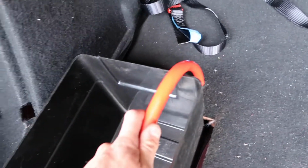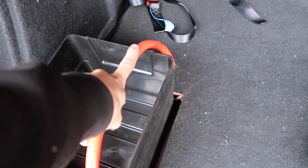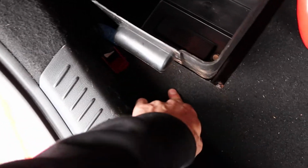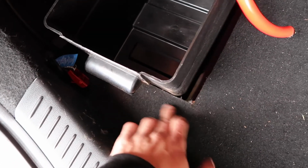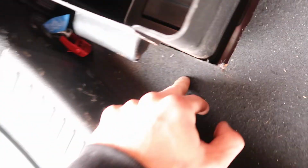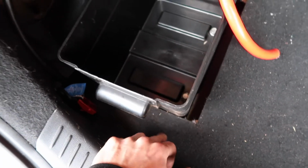It is still secured in place. It's not like it's gonna go anywhere. It's completely bolted in. Fix up this cable coming into here, probably put the fuse in the battery box. And I ran a ground, which I drilled a hole next to. Well, there's a little rivet right here, and I drilled a hole next to it, which I grounded down the surface, so it was bare metal, and then nut and bolted that.